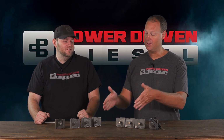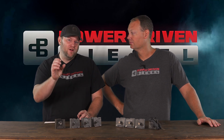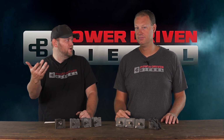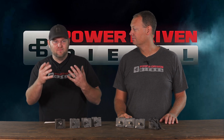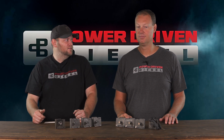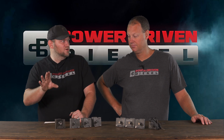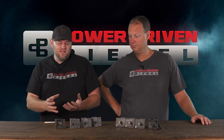So tell us about why these are so awesome. The big problem, first off, is factory rocker pedestals. They're very narrow and very low grade steel, almost like a pot metal. In fact, they're so soft they don't even show up on a Rockwell hardness C scale. They're barely on the B scale. That's like a piece of steel you buy at the hardware store to fix your fence or something. It looks like they're punched out or extruded in some sort of a die, so they're soft to be extruded. They're just very cheap things.